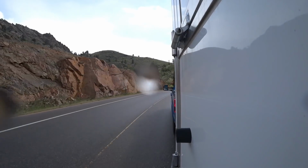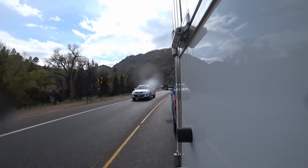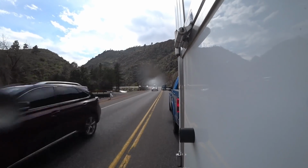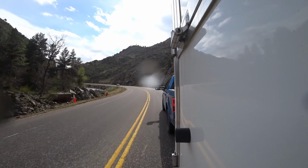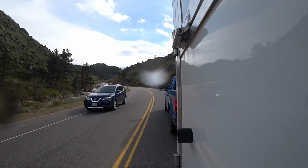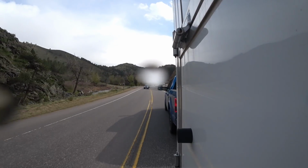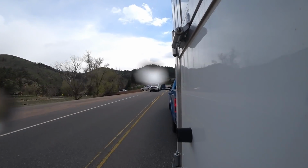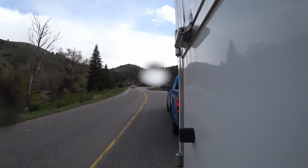But anyway, this is a 331 rear end, so that axle ratio, I would call it a fuel mileage axle ratio. It's not really a towing one. For the EcoBoost, to get the max towing package, you have to get a 355 rear end and all of that to get to those high numbers. On this one, you go to a 373 rear end, which I like, that's a lower gear, like what we're used to having, the old 410s, the old 373s. So if you wanted to equip for your max trailer towing, you get it up there in that 12,000 pound range. That's what you have to do.